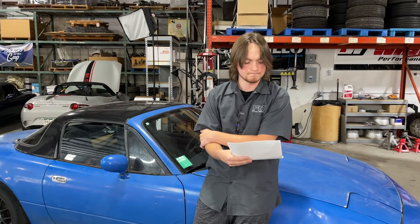Next: 'I replaced the window bushings but still get a lot of rattling, and the soft top makes a ruckus bouncing to the beat of bumps in the road.' First, check if you still have your soft top stoppers — the little circle screws or plates just behind the seats. Those stop the soft top from going too far and bending the frame, and could be causing that bounce or rattle. Another option is a soft top cover that clips into the belt molding around the back of your car and holds the soft top down when it's folded, which may reduce rattles.